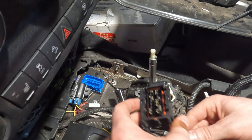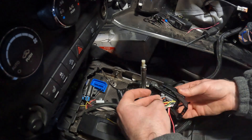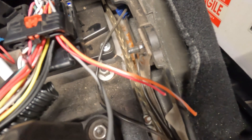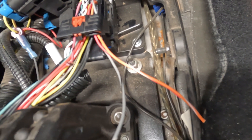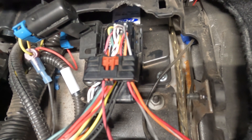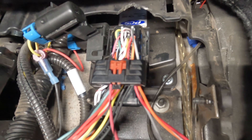I've got two extra inputs already. I finished moving some of the wires around and provided about four digital inputs. I made sure to wire one into digital input 12, that way I have a switch off the key to dim the actual lights on the shifter.